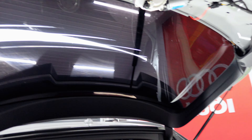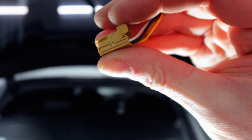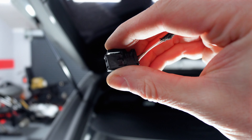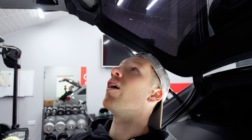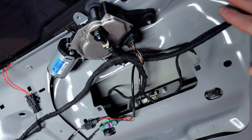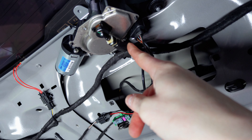Right, so that's the back off. Let me show you what it's looking like. You can see these are the clips I've just been getting off — easy to do when you don't have numb fingers. That's the one for the boot release button and this one for the light took me ages because I had to nip them in. So what I'm looking at under here is the washer jet pipe. I think it's this one that just runs around and goes in there. There's no water in here so there's definitely no leak from here — I'm hoping it's just a blockage in this pipe.